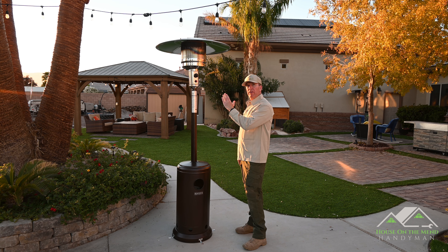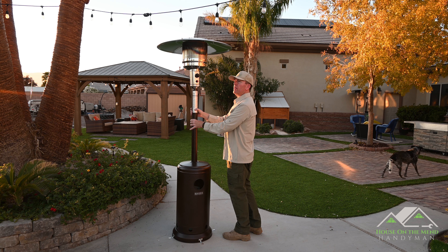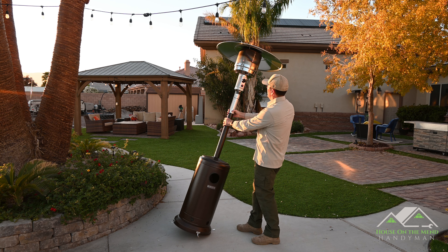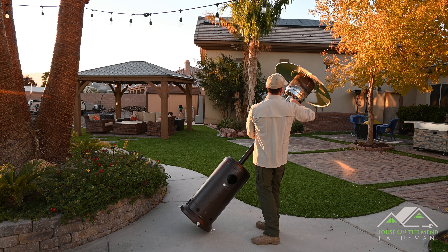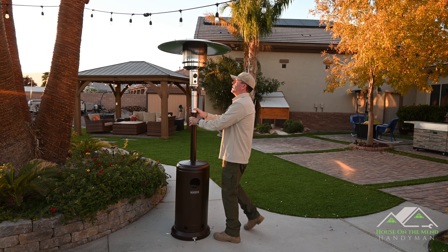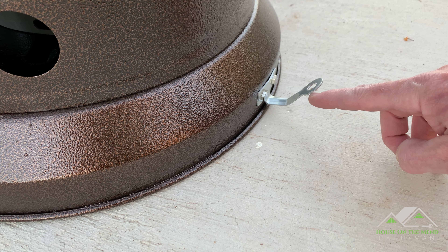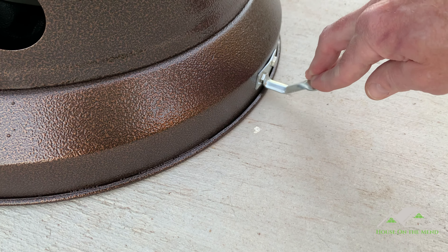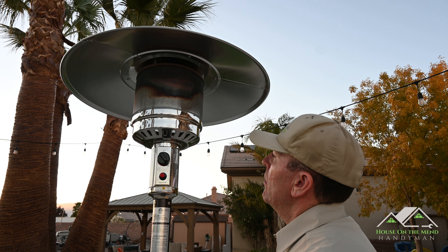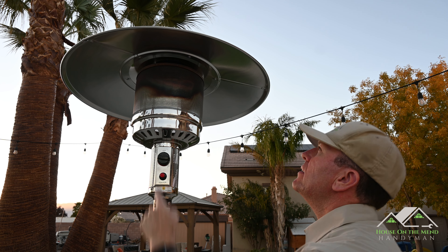In the Amazon listing there's a safety feature that senses if the unit pivots in any direction 30 degrees, sensing a fall, and it should automatically shut off. Let's test that right now — the unit's going, I can see the flame and hear it hissing away. Let's rotate it — and there it goes, I can hear it shut off! However, when I tipped it over to perform that safety function, it bent this really weak flimsy metal foot. I can push on it back into place with minimal effort — that is not the strongest piece of metal.